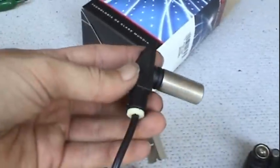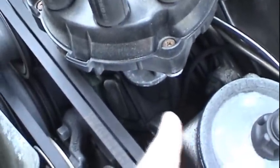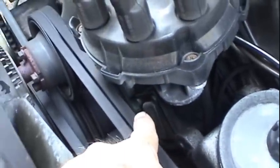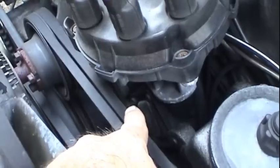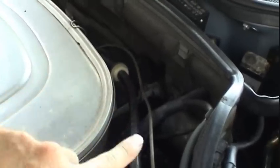And what's going on, this is on the Mercedes, it's actually mounted all the way back against the flywheel back here somewhere. On the Mercedes, you can't see, but you've got a cylinder identification sensor on the crankshaft damper. I think that notch right there is actually one of the notches for it. And its output can be taken right here. But you've also got the crankshaft position sensor on the other end, on the flywheel, with the same idea. You've got notches built into it, and each time a notch goes by, it triggers a pulse to be read